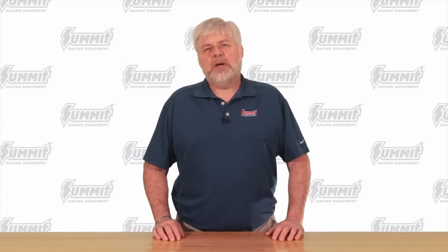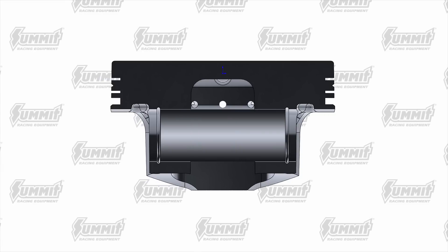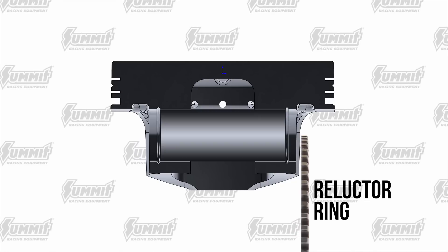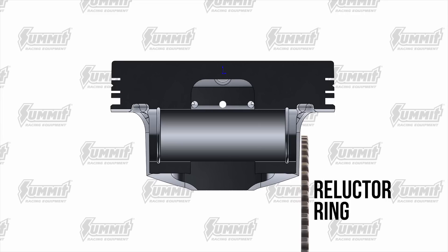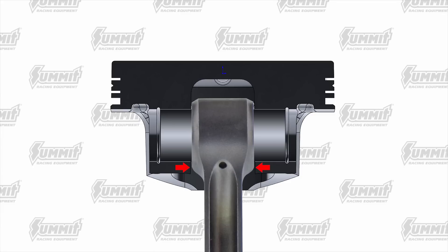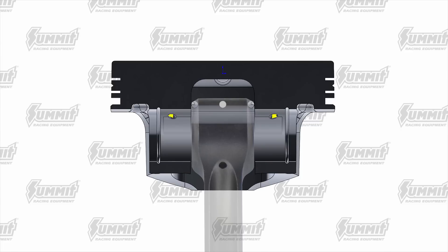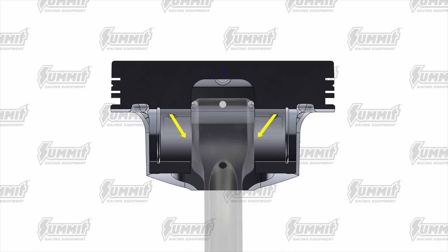The link between the piston and the connecting rod is the wrist pin. Summit Pro LS Pistons are designed around a 2.25-inch pin length for several reasons. Pro LS Pistons don't need to be notched to clear the reluctor ring in stroker applications — forgings have a grain, and cutting across it creates a weak spot that can allow a crack to start. To maximize pin and pin bore life, the pin boss span is moved inboard and captures the factory connecting rod small end perfectly, reducing pin flex by putting it into shear rather than bending. The forced pin oilers lube the pins with every downstroke, and the design maximizes bearing area for reduced pin bore wear.